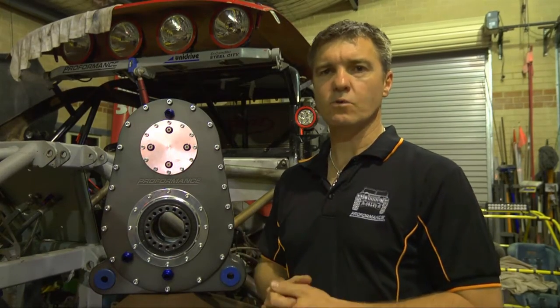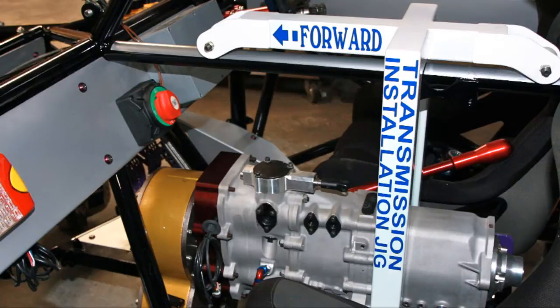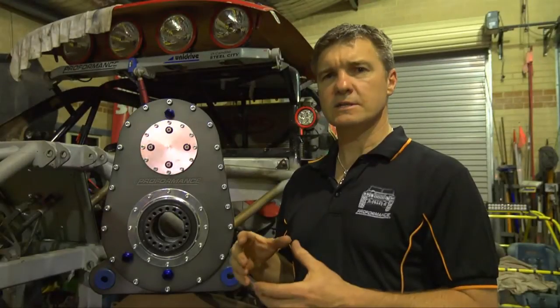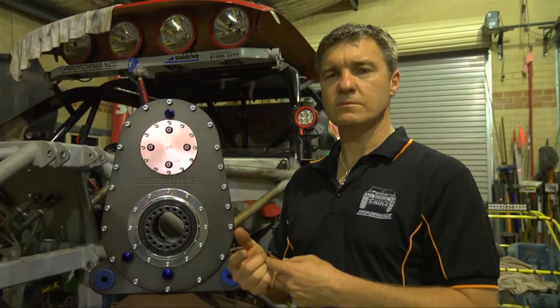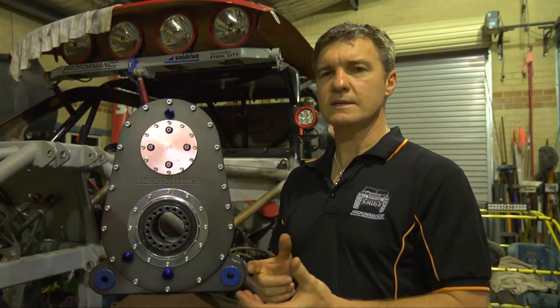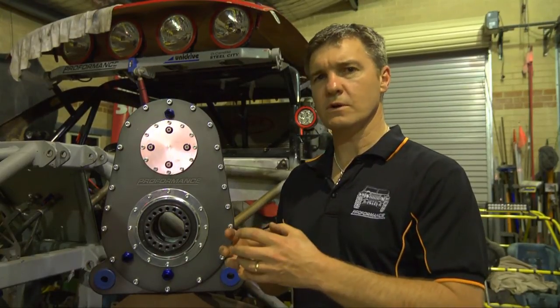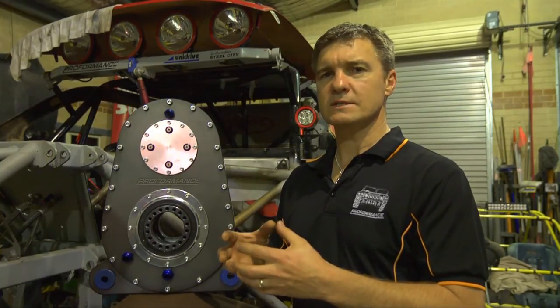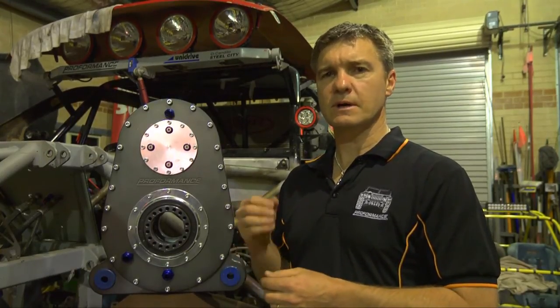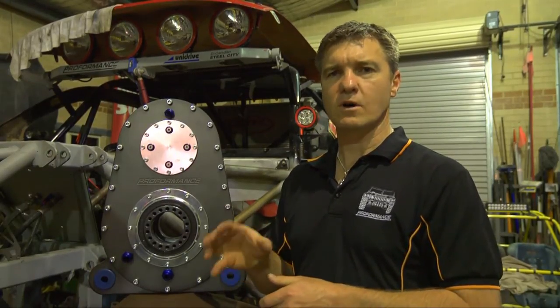One of the big problems in running mid-engine or rear-engine off-road racing vehicles is that having the gearbox between the driver and navigator results in the tail shaft operating in the wrong direction. A lot of competitors will actually flip the diffs upside down to reverse that problem. Unfortunately, it's not ideal. In a previous technical article written by Proformance, we explained that running a differential upside down results in the diff gears running on what's called the coast side of the differential. Running a diff on the coast side means the differential is in a much weaker configuration and much more prone to failure than running it in the correct drive-side configuration.